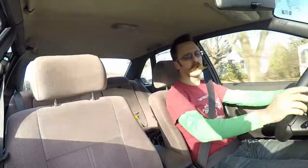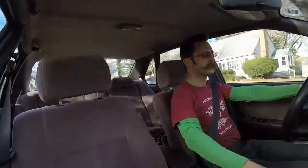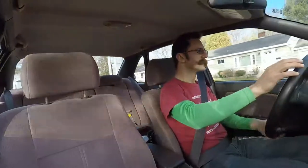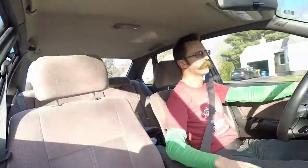Maine winters, we get a lot of snow. I have a bunch of different properties I have to get around to. So snow tires, jacked it up, took care of that. When I got it, it very much just felt like driving a couch around — super floppy. It didn't lean a whole lot because there wasn't a ton of suspension travel, but it was just floppy. It's definitely a little stiffer and more controlled now with the fresh springs on it.